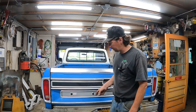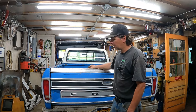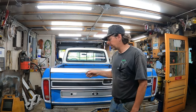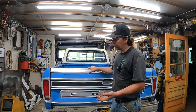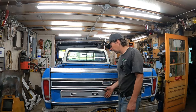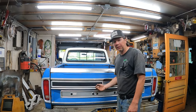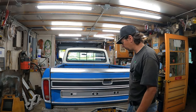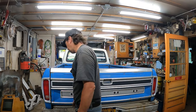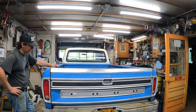In this video we're going to fix the box. But first the rear gas tank has to come out. When I bought this truck it has two tanks and I just run it on the front tank. The rear tank - when it had dual wheels on it they'd extended the filler neck into the fender, and it was all leaking and dry rotted. I didn't use the rear tank. Then when I took the dual wheels off I couldn't find a filler neck, so it sat with moisture and rust in it. It's been leaking from the straps a little bit, so the rear tank is junk. Before I do any welding, I want to take the rear tank out. I'll unbolt the straps, drop it out, throw it away, and eventually get a new one - they're pretty cheap, like $120.